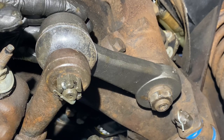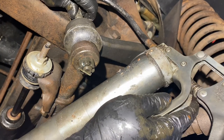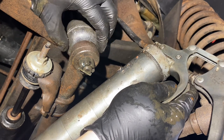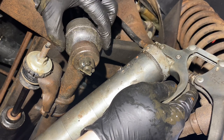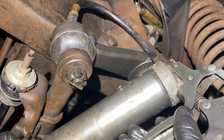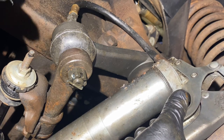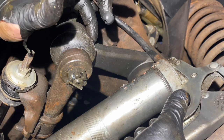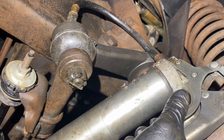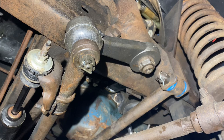Now all we've got to do is fill it full of grease and that's a done deal. Grease gun here — pop it on that fitting. When you're pumping this full of grease, watch this boot. When you see the boot start to expand, don't overfill and have grease shooting out because that means you may have torn the boot — you'd be defeating the purpose. Watch it; when it starts to expand you know it's full. It came out the side — sometimes you can't see them expand. Once you've got grease coming out like that it's fine; it didn't tear the boot, it just came up out of the upper part of the seal. Once you see grease come out you know it's full. After driving it a bit, come back and check it and give it a pump or two because driving will work the grease in more.